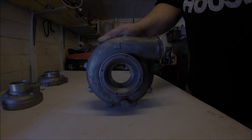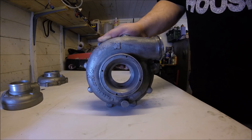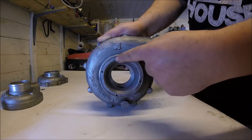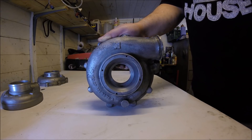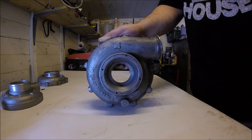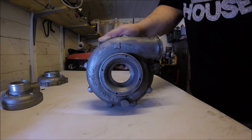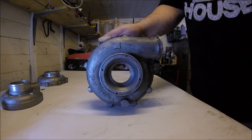The final variation of compressor inlet is actually how the majority of anti-surge inlets look when fitted to an OEM production vehicle — that's with some kind of trumpet-shaped ring around the outer edge here. While some sellers try to call these things 'race covers', which obviously helps sell turbos, in reality all they are is silencers to quieten down the loud spool-up noise that all anti-surge compressor inlets make. It doesn't completely silence it, but OEM customers don't find super loud turbo spool-up as awesome as we do.